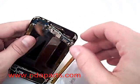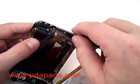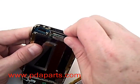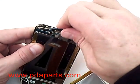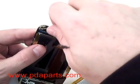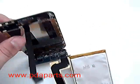You will now be able to remove the board at the top. Watch out — there is a metal piece that is being held on with some glue. You will need to pry it up carefully to release it. After you get the board up, be careful: it will not totally remove from the unit, as it is still attached by a ribbon and a board at the bottom.